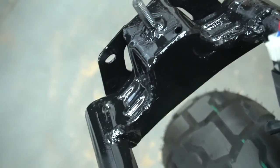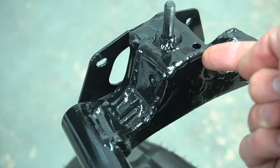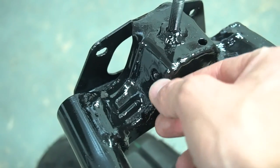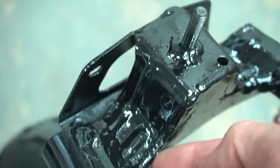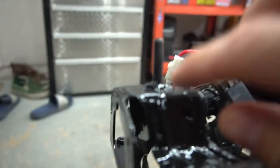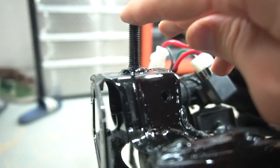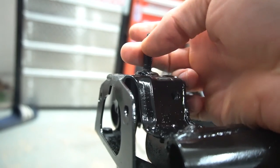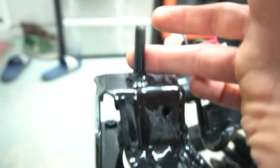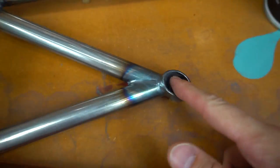Everything is now painted and the reinforcement is complete. I put in a flat piece of steel about an eighth inch thick, ran a bead all the way up and down — not the prettiest weld but I didn't want to melt the thin metal. Replaced the stud and ground off the allen key head so this lip sits almost factory — it's two millimeters so it sits up the exact stock amount. This Grade 12.9 bolt is way way stronger. My goal would still be to upgrade from M8 to M10, but I'd have to figure something out for the bar design since I didn't calculate that when we designed these.